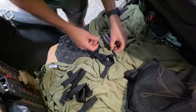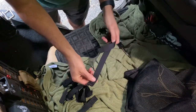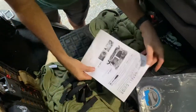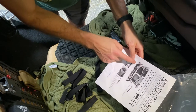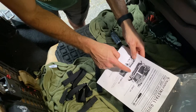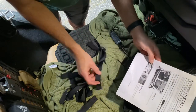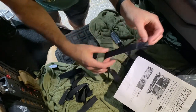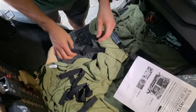You need a T25 Torx bit. Basically you use the four trim screws — the two trim screws behind the speakers and the two trim screws just before the rear arch, which would go right behind the back seat. You take those screws out, put the straps in, and put the screws back in, and then that gives you something to clip into. We'll go ahead and do that.